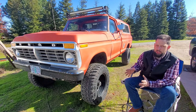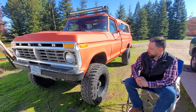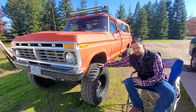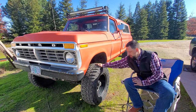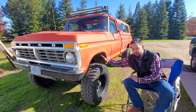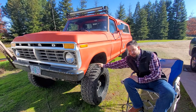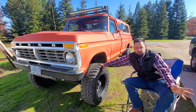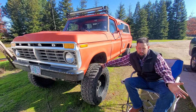She's on a six inch lift, obviously four-by-four being the highboy. We have some 35s here — Goodyear Wrangler MTR Kevlars. These are the same type I run on my '74-bodied 1979 F-150. We have some Blackrock custom wheels here, same as the Bronco along with the tire — both E-rated and the same wheel — so they're interchangeable between both eight-lug trucks. These also match Robert and Kimber's camping trailer, what I call the trail trailer, so tires and wheels can be interchanged between the camper trailer, the Bronco, and this pickup truck. You have two spares that will work on almost any truck, or you can pull one off if you wind up in trouble on the trail.